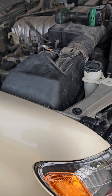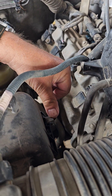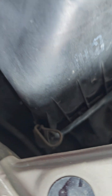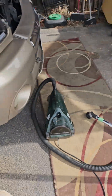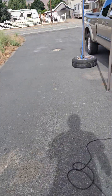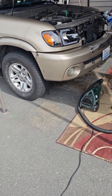To check the air filter you have to take these clips off — there's one there, one on the other side, one down here, and this one is backwards. You push this little thing down and that releases the clip on the bottom. I lifted that up, got my air filter out, and from the top it looked really good — that's the clean side going into your engine. But I pulled it out and pounded it on the asphalt, and that's some of the junk that came out. Then I took my leaf blower and held it right up against the back side and blew all the dust out, then continued smacking it on the asphalt. It's pretty clean now — I put it back in and put it all back together.